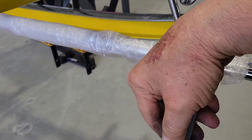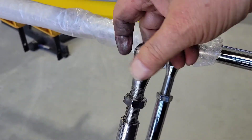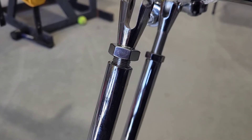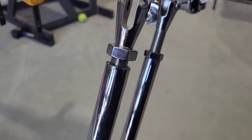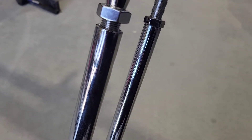And that's what I'm talking about right there. So we'll just loosen the nut up. I'm going to stop right there with it so that I still have about a quarter inch of fine adjustment when I finish putting it all together. Then I'll make the spacer in the back to fit that quarter inch of play. And you can see by how long that was on the other one that I've got plenty of thread engaged in the hairpin there.